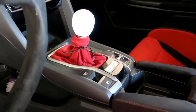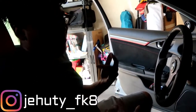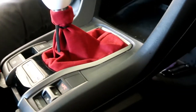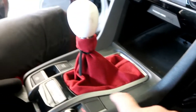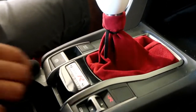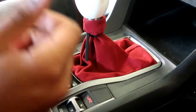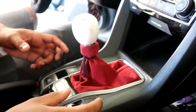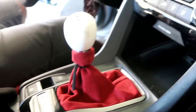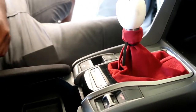Here's the shifter he already has — it's a hybrid. So we got my helper right here. He's going to show us how to do it. Pretty much you got to take off this trim first, and then there should be two bolts underneath. So you just got to unclip the harness underneath — there's two bolts. Two bolts right here for the top plate. Take that off. Make sure you unplug the harnesses for the controls. And then straight forward from there, all you're really going to need is a trim tool remover and a screwdriver.